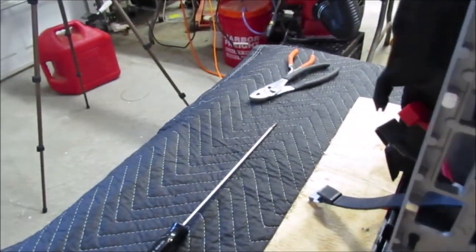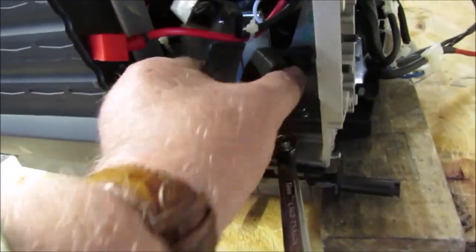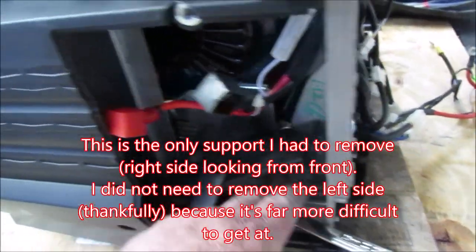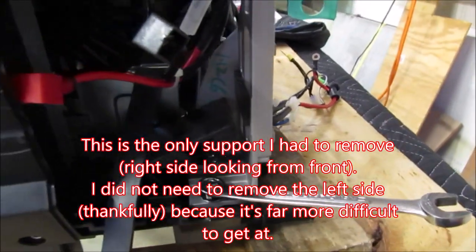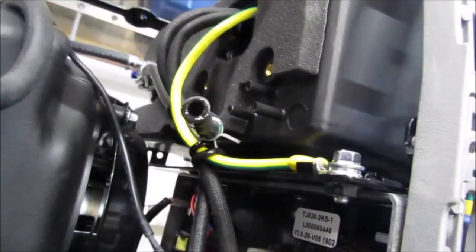Now I need to remove these two bolts on this bracket because they're attached to the front. I think I've got everything else disconnected — just gotta cut this tie wrap because it's connected to the ignition module. Once I remove those four nuts from the studs on these two side supports, I should be able to pull the whole front panel out. On the battery compartment side, there's a rubber floor for the battery — pull that back and you can see the two nuts. One you can probably get a socket on without too much trouble. On the other side they're hidden, so there's a little more work there.